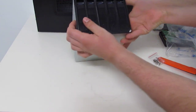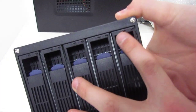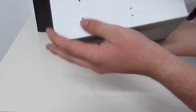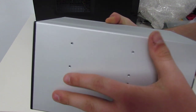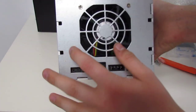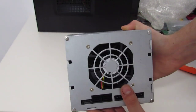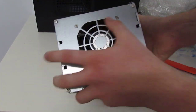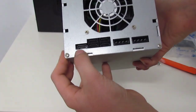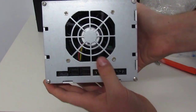That's the front, and of course we have activity LEDs up the top, one above each drive bay. Moving along to the side, as I said before, you've got room to screw in all your screws so you can fit this into the side of your case. At the back, we have what looks to be an 80mm fan — it doesn't come with any manuals, so I'm guessing it's an 80 or a 92. We can also see five SATA plugs at the bottom, and two molex connectors to power the entire bay device.